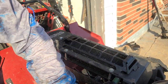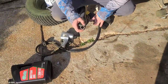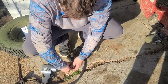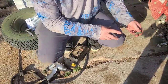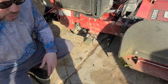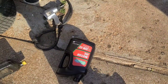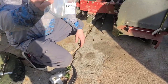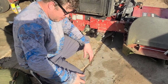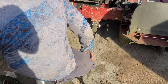So you have this right hand, left hand separate. First thing you gotta do, get this up in the air and take the tire off. If you got an impact, you can take it off after it's in there. If not, you gotta break it free first — it's a 13/16th lug. You're gonna need an empty bottle or one-quart bottles of 20W50 conventional, and you're gonna need a hand pump. Then you're going to need a 9/16th socket.